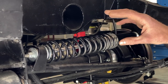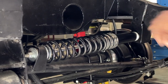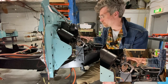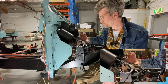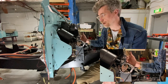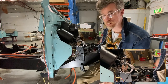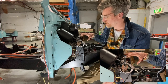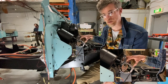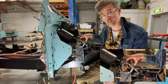And particularly on a vehicle like this, which traditionally had a very active return to center in that you needed to turn the wheel. What you'll notice is that when we talk about power steering, we're not talking about a full replacement of a hydraulic system from, say, an early Range Rover or a Discovery One that then modifies the steering and has that steering box, the power steering unit down the front of the chassis. We are amplifying and assisting the original steering mechanism, and that's by putting an electric motor driving the steering shaft on the other side of the firewall.